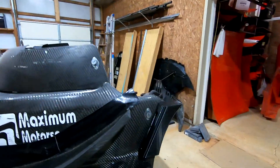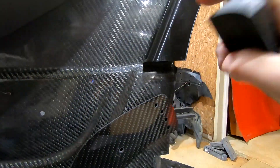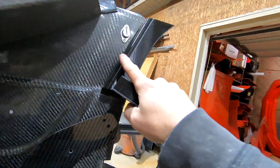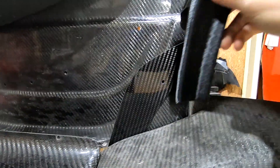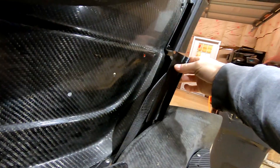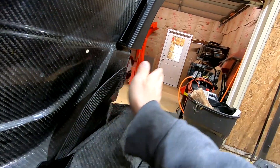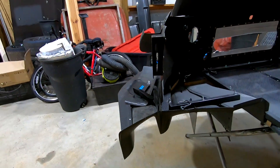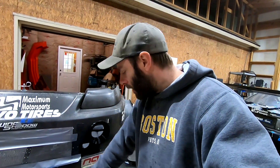Here is the 3D printed part. I did a video on these little air curtain/air skirts — I'll put a tag up here as well. I need to remove the splitter flap since we're not running it anymore, and then this part nestles down right about here. From the front and side you can see it blocks the tire and gets the outwash going out sideways beyond the tire, which allows the splitter tunnels to extract air a little bit easier.